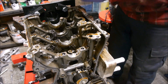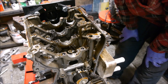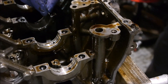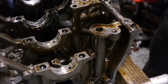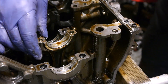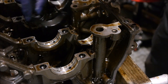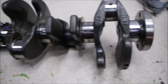So that wasn't good. I think we have minimised - whoever was running this car has minimised the damage to just a crank and a conrod. And that is still fused in there - that there is the bearing fused inside it. It should look like that one there, which is nice and silver, not black and burnt. So I think it's going to need a new conrod because I don't want to trust that - it will have had a bit of heat treatment. But that can be a nice souvenir. Crank out.